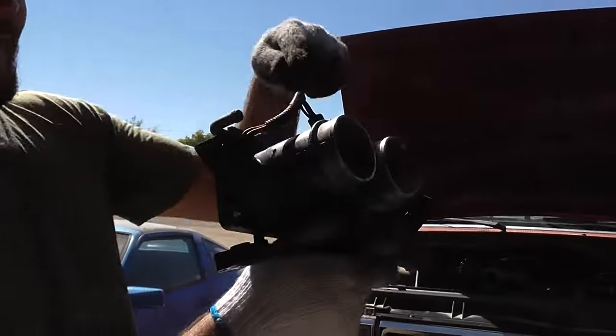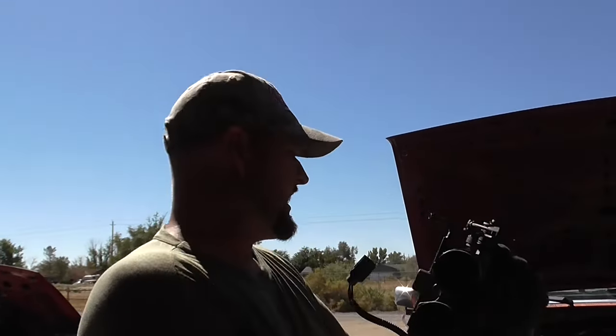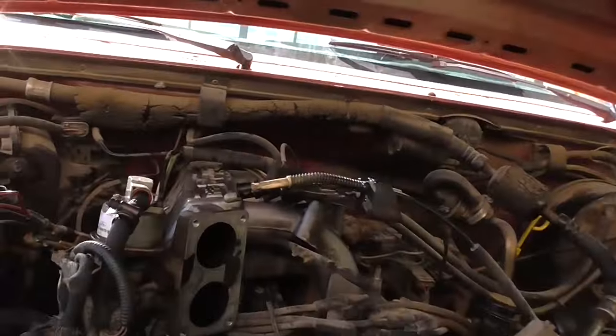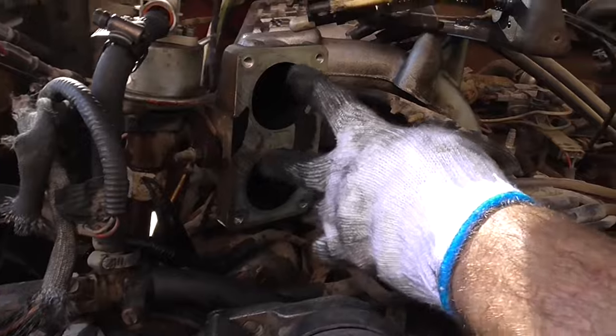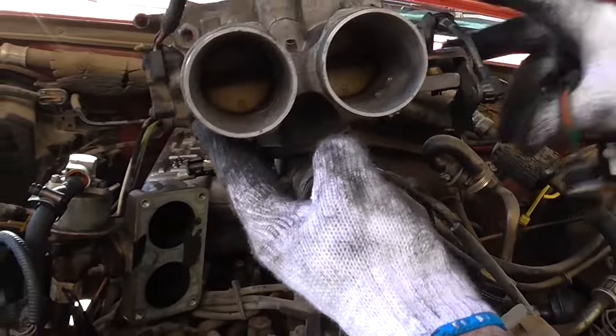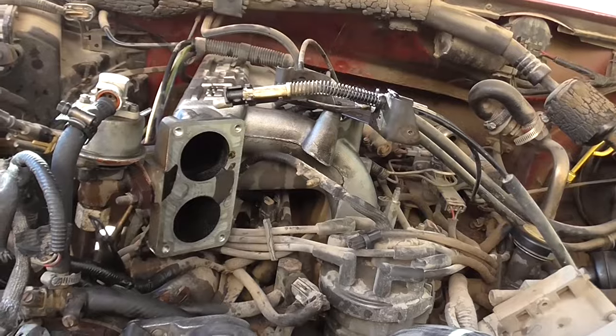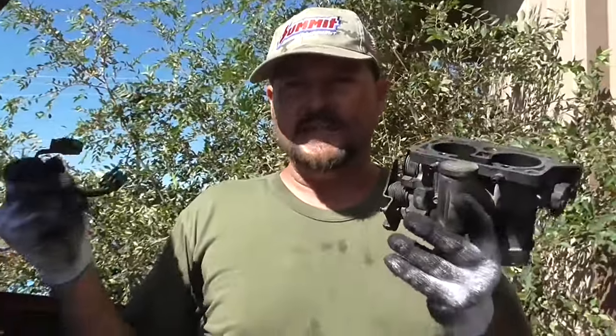Once you've done one throttle body and you know what they're all about, you can do any throttle body. The easiest way to find a throttle position sensor — look for the throttle. The opposite end is your throttle position sensor. This will work on all your Ford 302s, Ford 351s, and I believe the 460s have the exact same configuration because they have the high-rise intake manifold, so they orient the throttle body differently. Most throttle bodies are horizontal, but Ford went vertical, so you have to take all this stuff off to get to it — that's why dealers and garages charge quite a bit for this job.